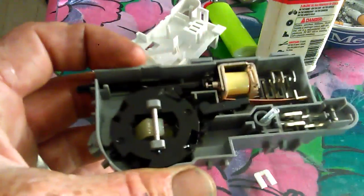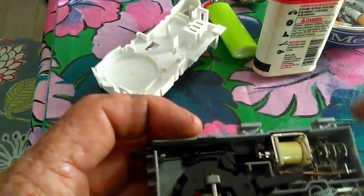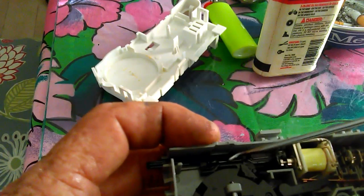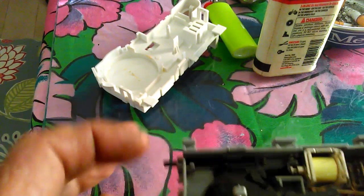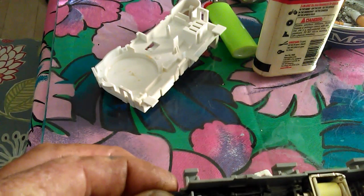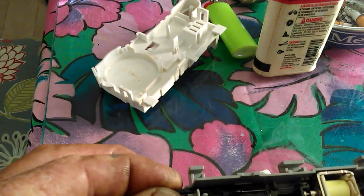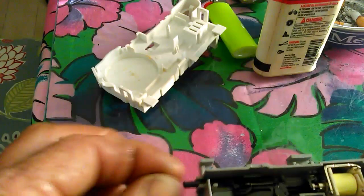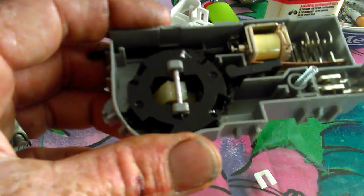Or if you have it open and it's locked, it will not shut. So before you replace this whole unit, take it apart, pull that top spring off, and make sure that the bottom spring is seated in there. Each time you press on this it won't actuate right now because it's in the open position, but it's supposed to move up and down — just like on a ballpoint pen.